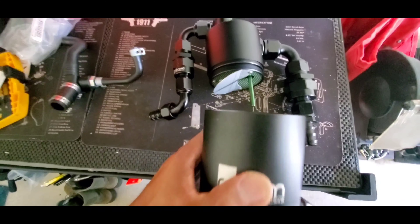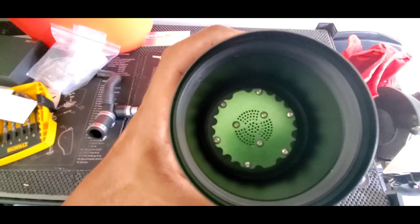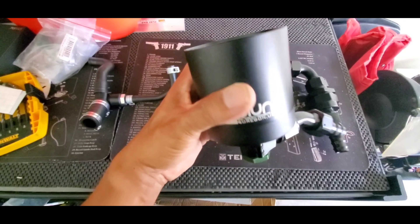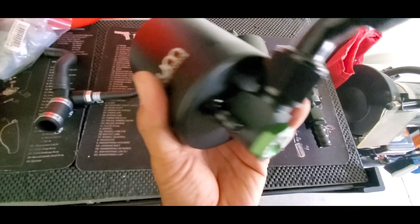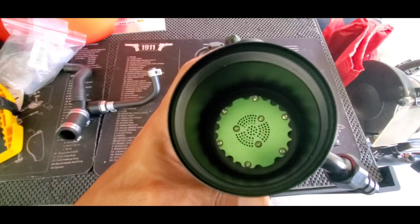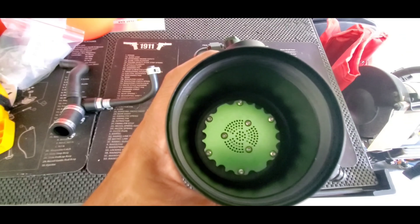Here it is. Here's the bottom port — it goes to a banjo that goes in this area right here. That's the heater plate as well as the initial baffle at the very bottom, which is going to stop or diffuse some of that oil mist coming from the crankcase. There are two barbs for coolant hoses because this is also a heated option, but I'm not going to use it because I'm in Hawaii.